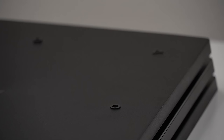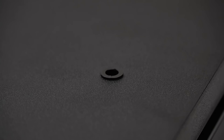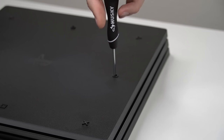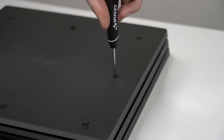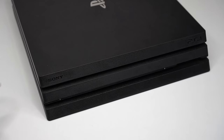Patience and being gentle is the key. But if you need additional information, you can refer to the link in the description to the PlayStation website. Now a little trick that I learned is a method that sort of recalibrates the disc drive, but I only recommend doing this when there is no disc inside the system. All that you gotta do is just give the screw a few turns in both directions. Sometimes if your PlayStation 4 just won't take discs, this can a lot of times fix the issue. I do not recommend attempting this while there's a disc already inside the system, otherwise you might hear a clicking noise. But once finished, you can power the system back on and everything should operate as normal.